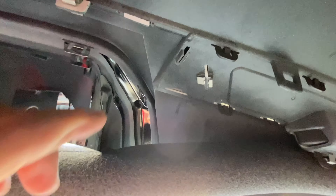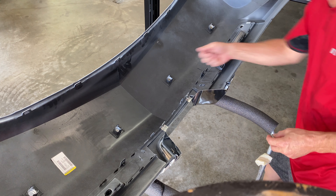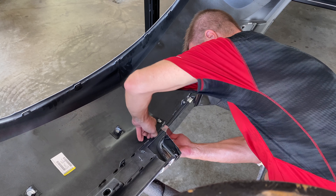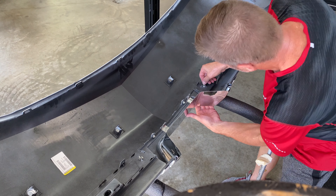You can clearly see they just cut this with an air saw - they weren't even shy about it. So here's the back side. You push these through and the clips have a little tab and they hook on the back side of these plastic tabs. I'm going to put those tabs around these pieces as well. These are the clips you need to hold these pieces in, as well as the back trim piece in this area. They're the same clips used to hold the front grills of the CTS-V in the front fascia.